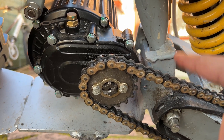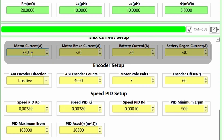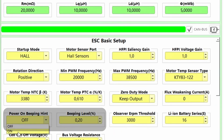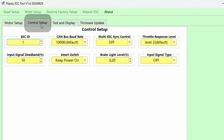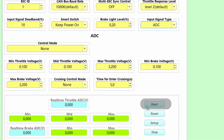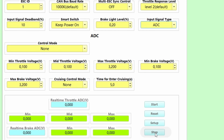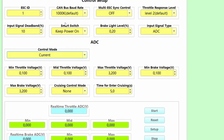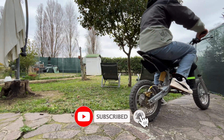My personal tip is to remove the chain or belt for more precise readings. You should now see results like this — at this point the motor is working properly. Set the right values according to your motor and battery specs. One cool thing is the power-on beeping hint; you can also choose the sound level. Then move to the control setup page, choose your input, click start, twist the throttle all the way a couple of times, click setup to keep the new readings, and stop. Choose the control mode, write setup, and you are now ready to ride.